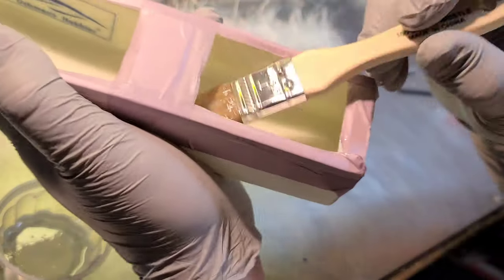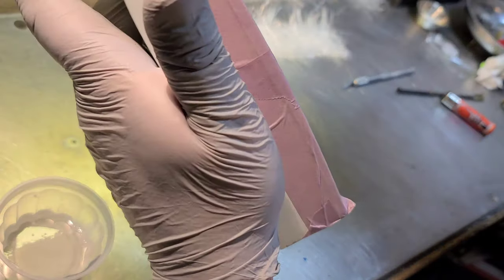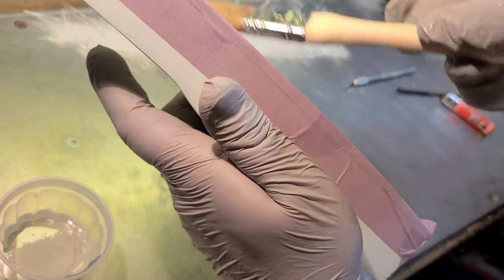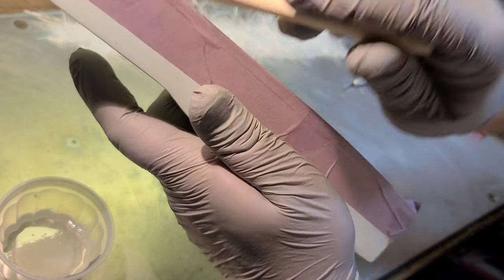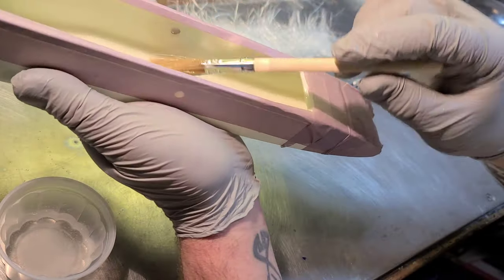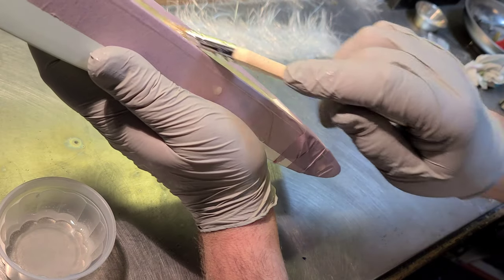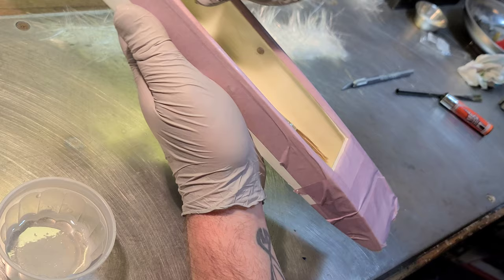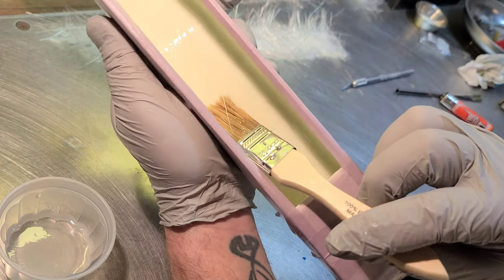This boat should be fast, and if we have any blowovers, we don't want the blowovers to just shred our newly built boat. So we're definitely going to reinforce this bad boy. This thing should get around 60 mile an hour, and when you have a blowover at 60, especially with this thin layup they used, and it looks like they only used one layer of woven mat, which is not as strong as chop strand mat. I did it again. So we're going to put that chop strand in and get some reinforcement going here.